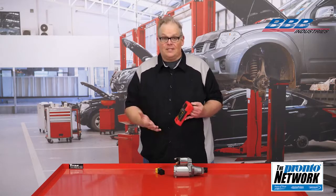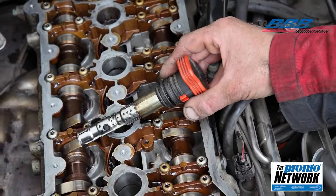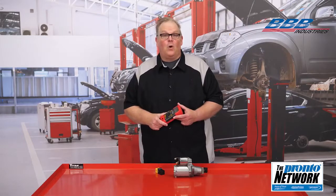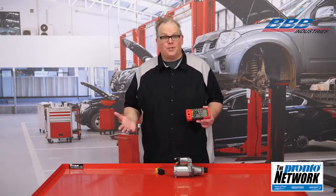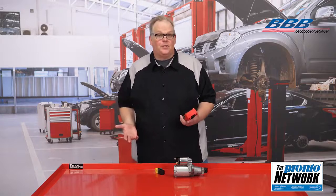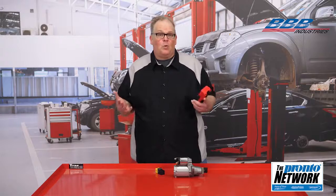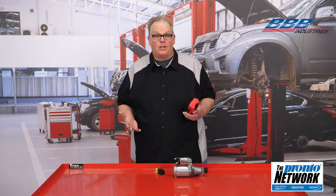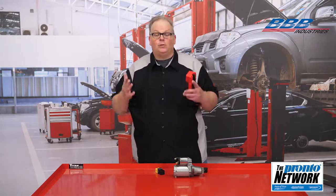When this happens, the ECM could shut down, the injectors will not spray, and the ignition coils will not fire. Testing for this can be performed with a scope recording system voltage or a meter set using the minimum maximum function for the voltages. Also, codes for loss of communication and system voltage will be set in multiple modules on the vehicle. Solving why the rotating electrical component doesn't work is just as important now as ever, but the diagnostic process is a whole new ballgame.